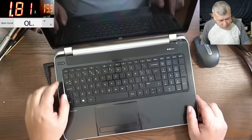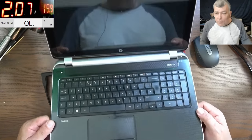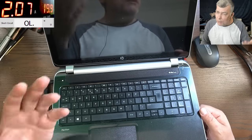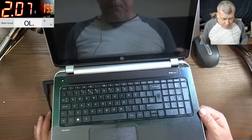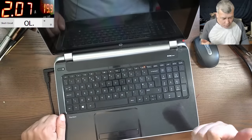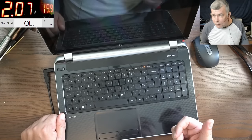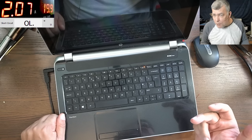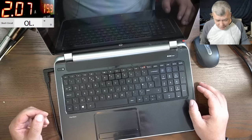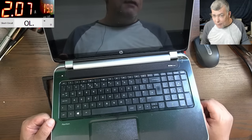This is a very tricky fault. I power on the laptop and you can see it's coming on — I can hear the fan but there's no picture on the screen. Based on the fact they told us it's a slow booting, that means it's probably booting after a while. Now, booting after a while can have so many causes: a faulty hard drive, a faulty DVD drive, a faulty Wi-Fi card, a faulty chipset PCH, a cracked solder joint where the chip gets hot and starts working after a while. So many causes.